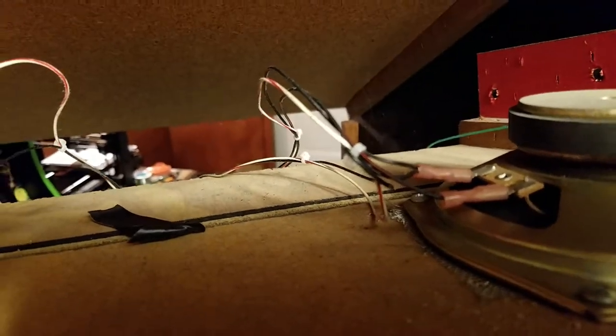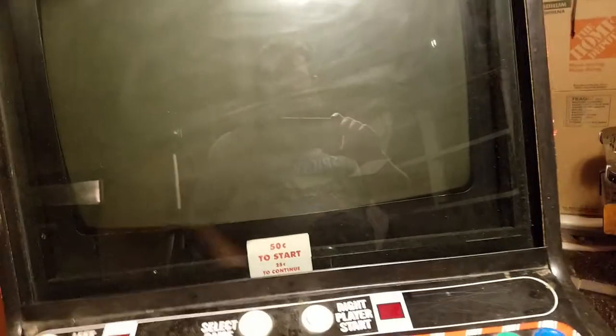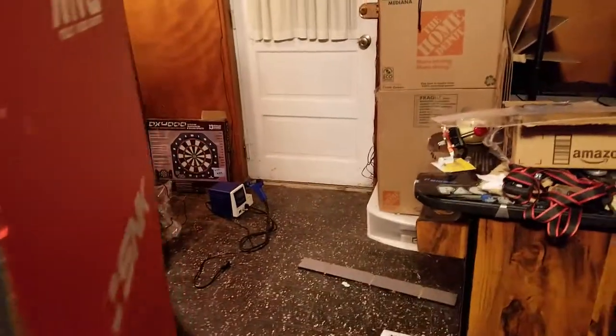I always had this feeling that the sound separation was not good, and I thought maybe a previous owner had wired the speakers for dual mono, because this originally came to me with a one-slot board. So I decided to take a look at the audio. I came up here, disconnected the left speaker, and flipped the cabinet on to see how it sounded — and I got a great plume of smoke from the back.